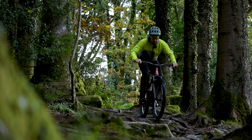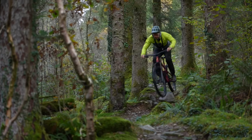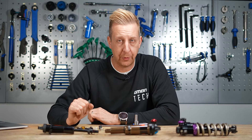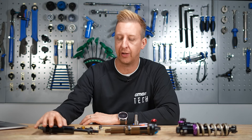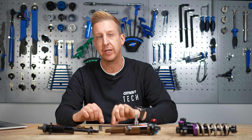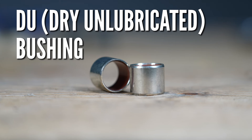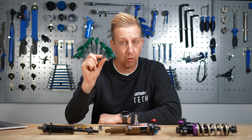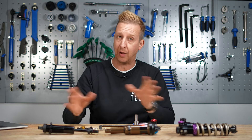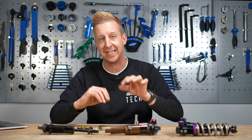It's kind of an ingenious approach to making sure all lengths of shock maintain the same feel. There are two major types of bush that go into the shock itself: the poly, sometimes known as an igus-style self-lubricating bush, and the DU, which is a dry un-lubricated metal version. You tend to see the poly ones on RockShox shocks and the DU ones on Marzocchi and Fox, though you can use whatever you want on whatever shock because the fitting is the same.